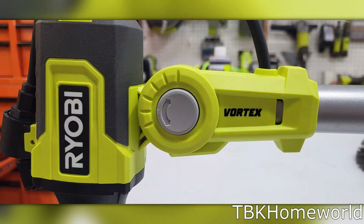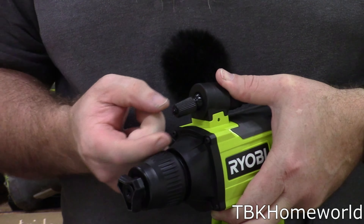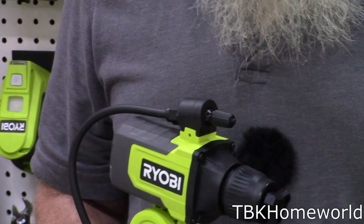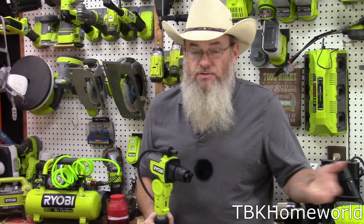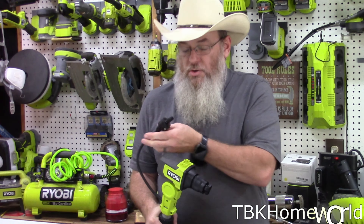On the spray nozzle, one thing I didn't mention is it's actually adjustable — you can point it up or down. I was trying to see if you could pull off the outer plastic shell to remove and clean the spray tip, because especially here in Texas we have a lot of hard water and limestone, and tips like this will get clogged literally within the first day you use it. Having the ability to unscrew and soak the tip in CLR would make a huge difference. It's not removable on its own, but the whole spray assembly is removable, so you could dip the whole thing into CLR.